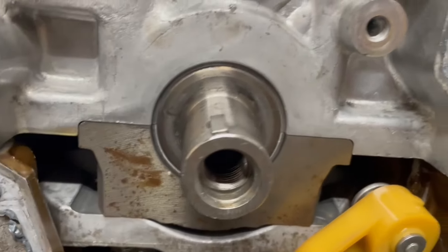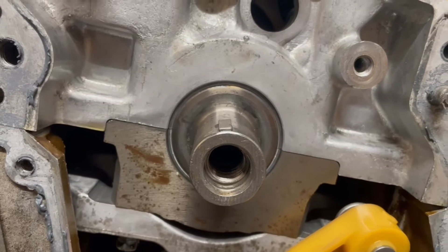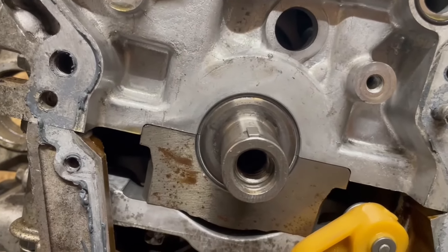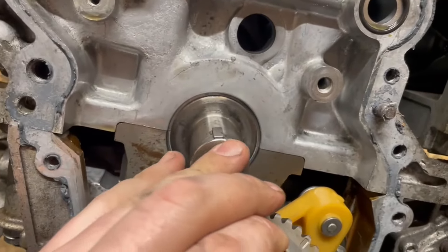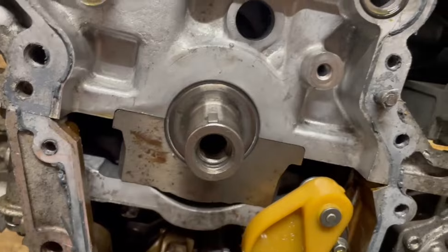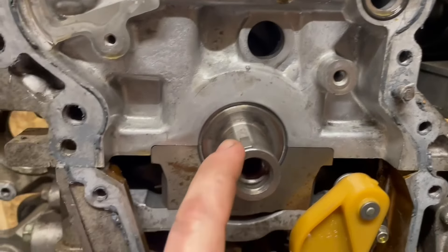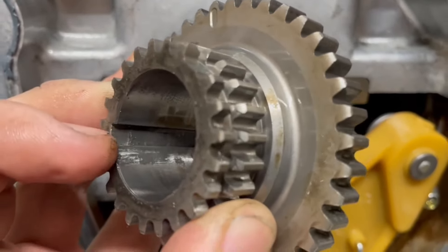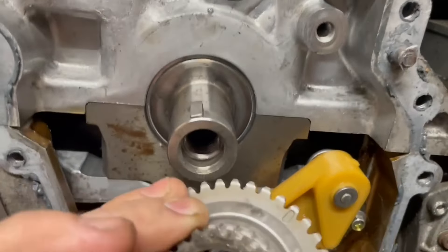We're finding the limit of what the nose of the crank can take. We might have to do something like a crank support, or we're going to need to come up with a sleeve. We're making a lot of torque if we're doing that. An alternative solution that just dawned on me: all of the torque pressure is going on to that one key, which actually only sits half of the key inside of here. You can actually see where it stops. So the solution might be to just extend that keyway back to give it more bite.